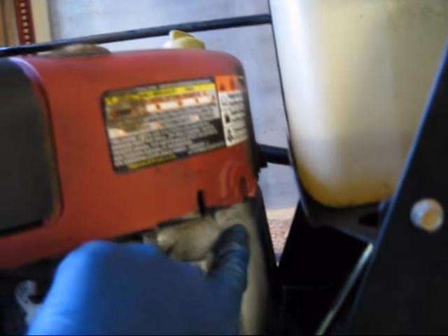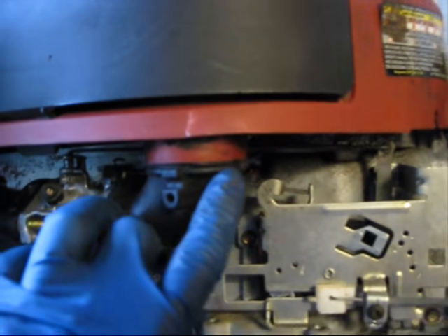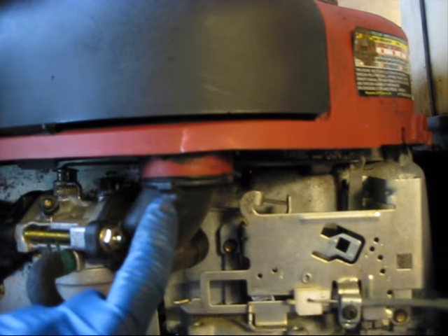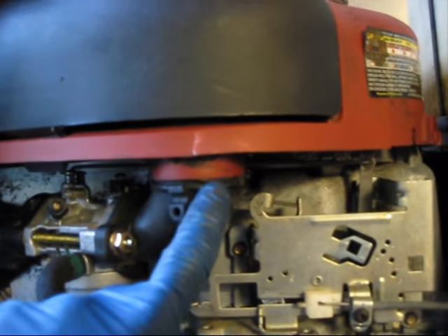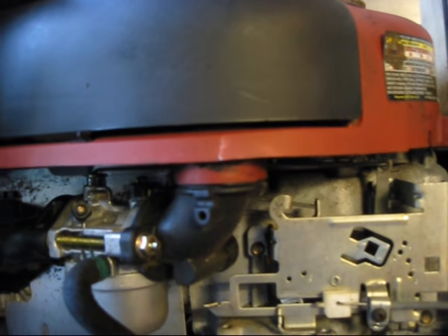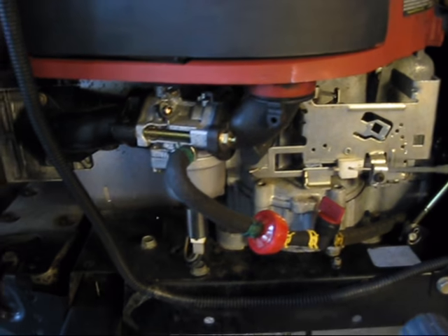This has been messed with before. I know because it's missing the bolts that hold the shroud down on the bottom. And if you look very closely here, you can see that little piece — that's the O-ring that seals the intake to the airbox, and it's been pinched. That means someone took it off and put it back on, and when they put it back on it didn't seat right, so that's going to suck in dirty air. We're going to take all this apart and I'm going to show you why these flood out and how to fix them.